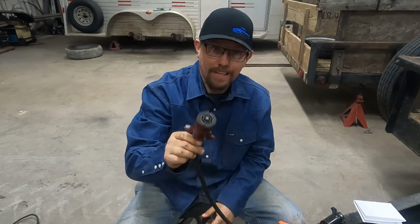So most of the time your white is your ground, but we didn't wire this trailer, so we don't know that for a fact. So the first thing we're gonna do today is we're gonna try to isolate our ground. So we're gonna strip it.